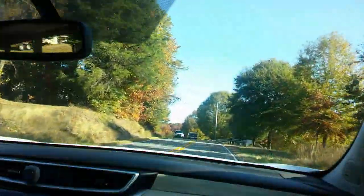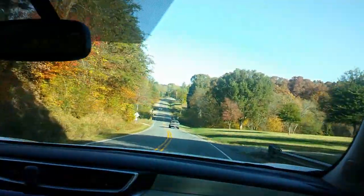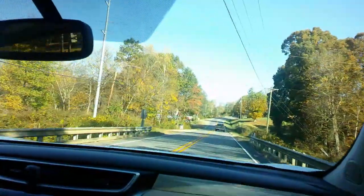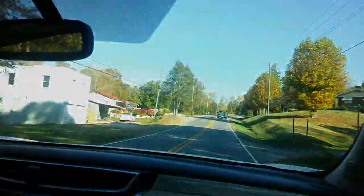Also, test driving will give you a feeling where if you've got a lug nut loose or the wheels loose on the car, you'll feel a vibration. But as long as you torque them down to specs, you shouldn't have no issues. So far everything feels pretty good. Just the normal road noises and bumps.